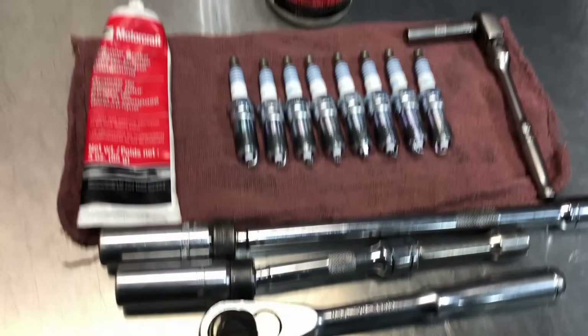Then slide the red locking tab back into place and that's it. The hardest part really is the electrical connector — getting it off without damaging it to access the coil and spark plug underneath. Repeat the same procedure on the next seven cylinders; they're all out in the open just like this one. You'll be good to go for another 60 to 80,000 miles — around 60,000 miles you'll start to see the gaps get pretty big, but they can go 80,000 with no sweat before you see any difference in MPGs or performance.